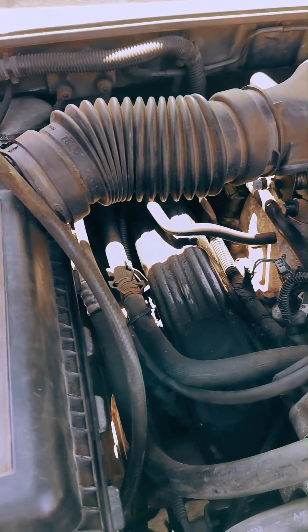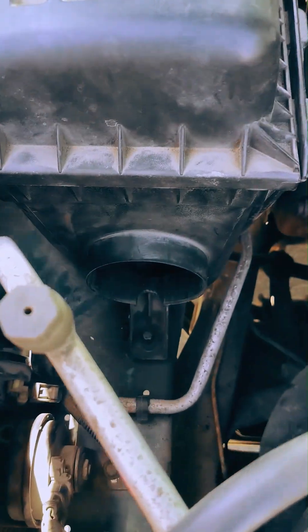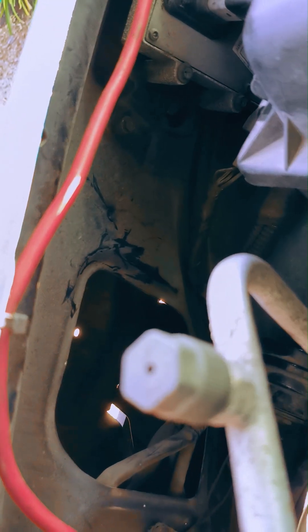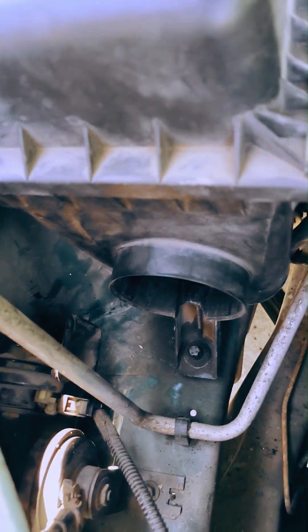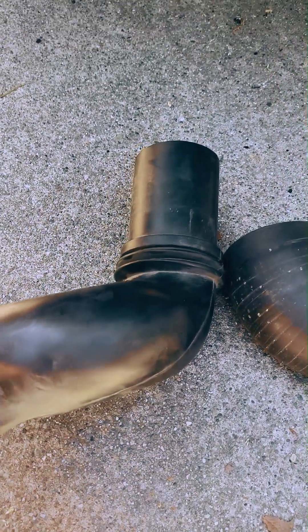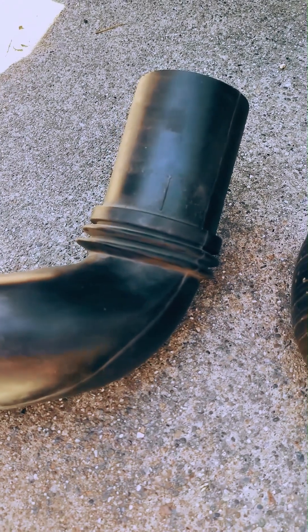Today we are improving the factory air intake box on the Dakota for not only a cool air intake but also ram air. The plenum hat above the throttle body has respectable volume along with the flat drop-in air filter and the three inch intake ducting. Our focus is modifying the plastic tubing that feeds the filter box by rerouting it from the factory configuration, which points to the fender but isn't sealed from under-hood hot air.